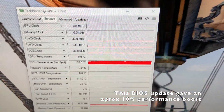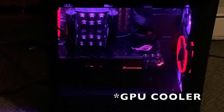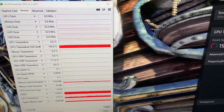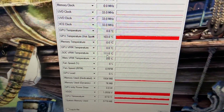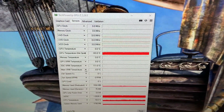There is one issue with the Strix cards: they recycle that cooler across all the different designs. So while it is big and beefy, they don't design it per-PCB, so this Vega card particularly has really hot VRMs. As we're running this benchmark here, we can see my temperature hot spot is at 103 degrees Celsius and the VRM temps are at 111 degrees Celsius — system-on-a-chip VRM temps. Those are really hot.